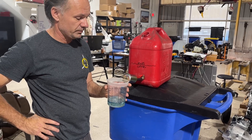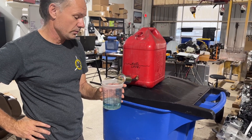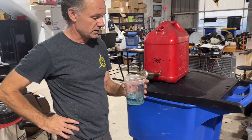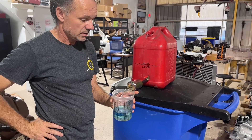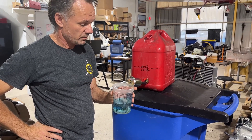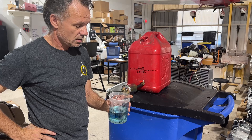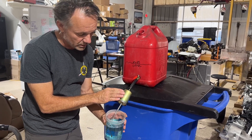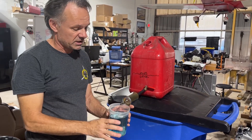If the filter is uphill it takes longer — clearly. Is the engine using this much gas? No, so there's plenty of gas going through. Going uphill is not smart; that's not the way it's supposed to be installed. You have to make sure the entire fuel system is downhill. Level makes a huge difference. Going uphill reduces the flow a lot. Level or downhill — the more downhill the better. There's definitely no restriction in this filter itself.